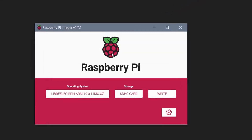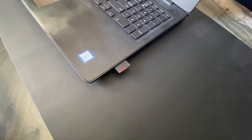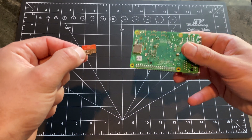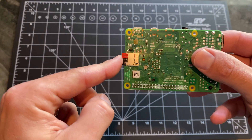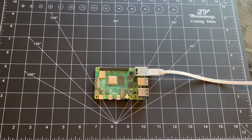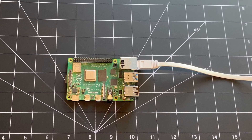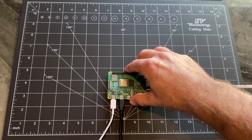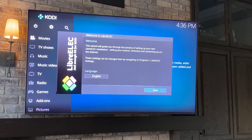Pop in that blank micro SD card and give it a go. Once it's done, pull it out of the computer, take it out of the adapter, and slide the micro SD card into the slot at the bottom of the Raspberry Pi. Connect the ethernet cord to an open spot on your network — you can do this over Wi-Fi too, but plugging in ethernet keeps it easy and quick. Before powering up, note there are two HDMI ports on the Raspberry Pi — the one on the left is your default HDMI output. Now plug in the USB keyboard and connect your Pi to power.